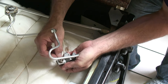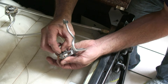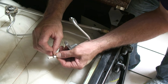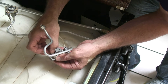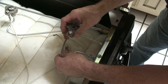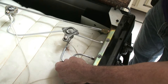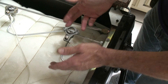First, I'm going to get my retaining clip back on here. Make sure that this little wedge part faces down — you want that to face down, away from your burner. Get it down in that groove, because if you look right here, you can see how it's grooved out. This collar is just going to snap right in place to keep it tight. So we'll take it and slip it back in the hole. I'll make sure I have it right. Now I'll take this and plug it back in, or I won't have an igniter. Now we'll put this back down. Snug it up — you do not want to over-tighten this. You just want it nice and snug. Once you get it snug, go a tiny bit more past it, and that's it — that's all you need.